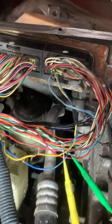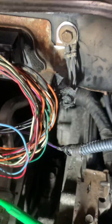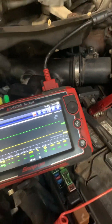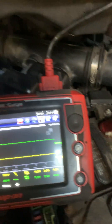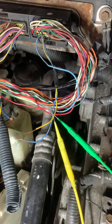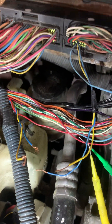There's a signal, and it's not clear whether the signal comes from the computer or not. So what I have to do is break the lines here. Something clicked in the IPDM box. Now I'm looking at my scope — I got no signal coming. Zero. That confirms that the network is active, but the computer is not broadcasting.